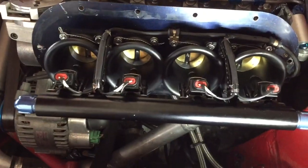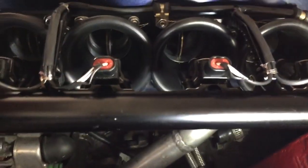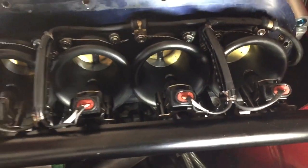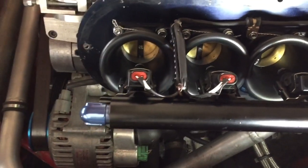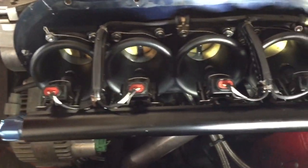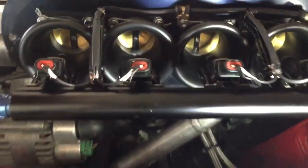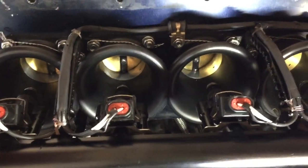This is where the original injectors would have sat. For high RPM settings it's perfectly adequate - the engine will flow fuel through with the butterflies wide open, so the fuel will flow perfectly fine. But for low idle settings, low throttle settings, and idle, it becomes a massive problem for the drivability side of things.